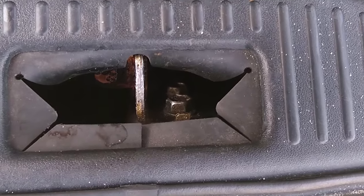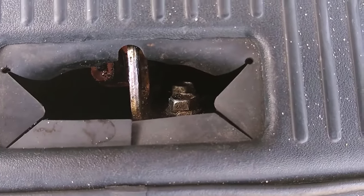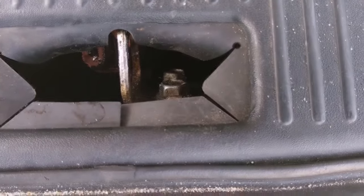Once you get it back to vertical, tighten the bolts — there's not a lot of space to do that, but you could use a socket which would probably be the easiest. I think what happened is the latch made contact and moved it over so it would no longer close. That's the simple solution. Thanks for watching Big Owl Repairs, and hopefully you subscribe.